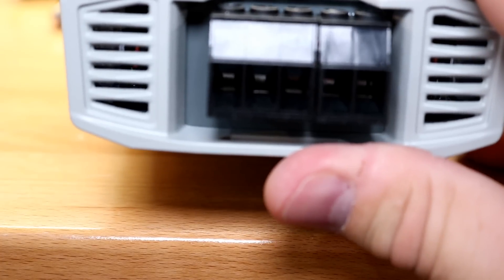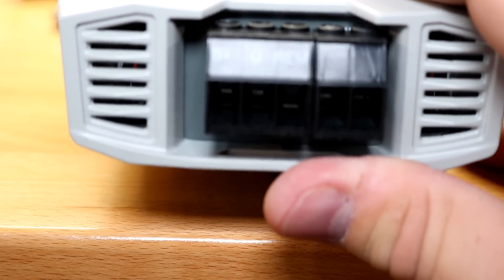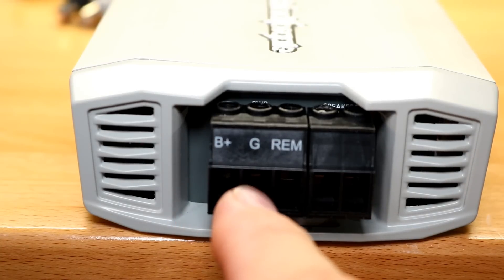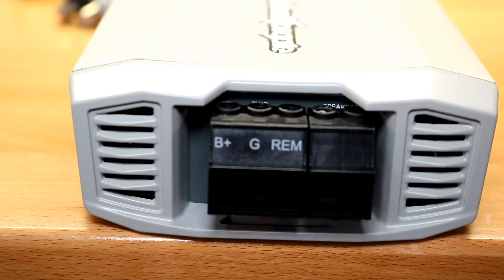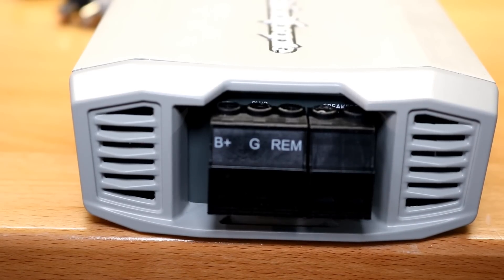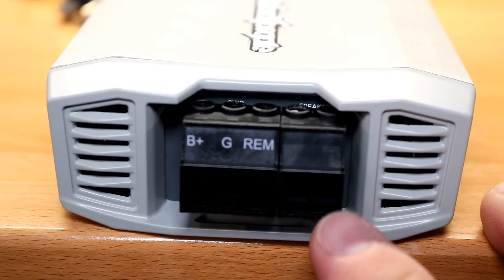These plugs are only 8-gauge max. This is a 750-watt amp and you're going to be really pressed to squeeze eight-plus gauge in here, and right next to it is the ground. You have to use 8-gauge raw wire — a reducer won't fit. They're so close together that one little errant strand of copper could short everything out, so be careful when hooking one of these up.